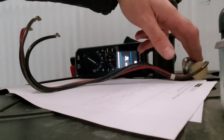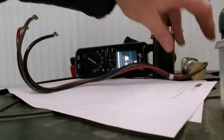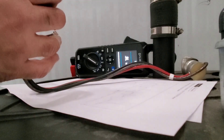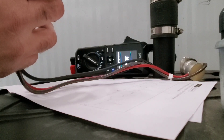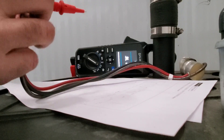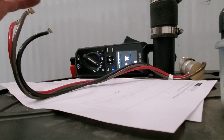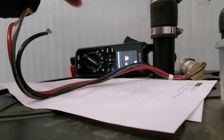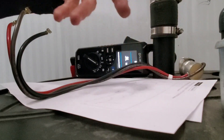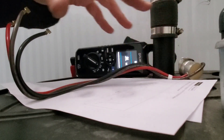I have the old one out. I held it in my hand for a bit, warmed it up to room temperature, and actually heard it click. Between brown and black we get an open reading, and between brown and red we have a closed reading — same as the new one. But that doesn't mean that inside the freezer at those extreme temperatures, this thing isn't acting up somehow. We're going to go up to the roof and recheck the situation we were having up there with the time clock, now that the clock has been changed.